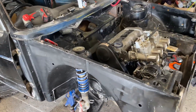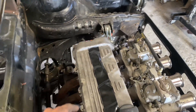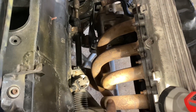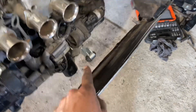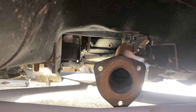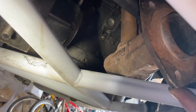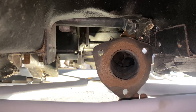That's the engine and box back in now. I've also got the exhaust manifold back on. Currently the engine is just suspended on this mount and this one here, which means it has movement. So now I can really fine tune that rear mount such that the exhaust manifold is sitting nicely and it's not going to bind up against the chassis. Looking at it from underneath, this is the exit of the exhaust manifold. If it goes up too high, the manifold catches on the chassis; if it runs too low, it's going to catch on the cross member.